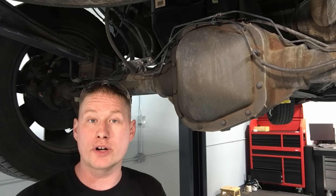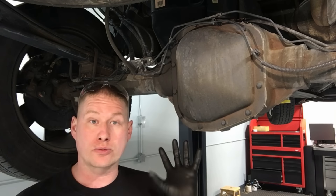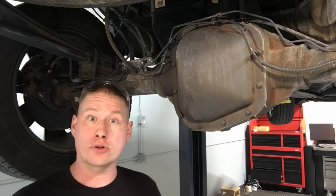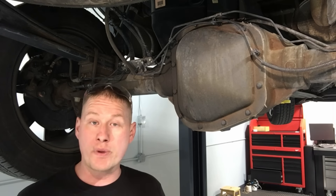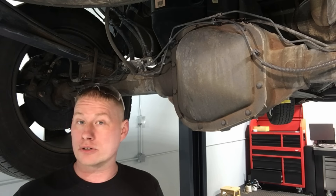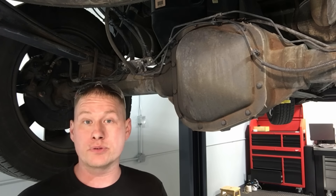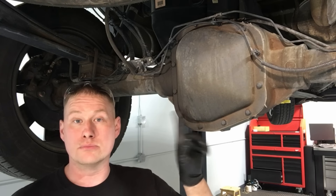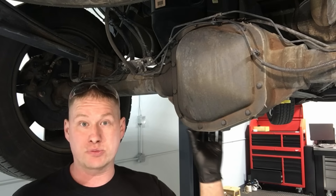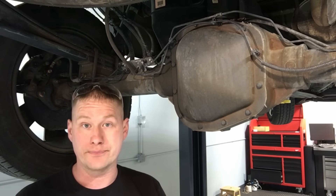Hello and welcome back to the shop. Today we're going over another critical maintenance item on your Ford truck — the rear differential. Think about whenever you're going down the road, this thing is rotating, being worked, hauling your vehicle and all the weight in the bed and towing whatever you're towing. It's only air-cooled, so if you're towing or hauling a lot, I recommend changing the fluid every 30,000 miles. If you're just putting around town, you can push 60,000 no sweat. We're going to show you the full procedure to change the fluid, including removing the rear differential cover and doing a full wipe-out — especially the sump, where all the debris sits.